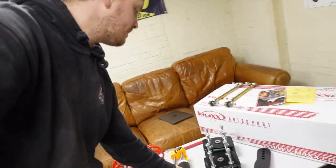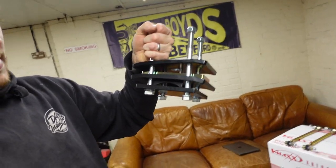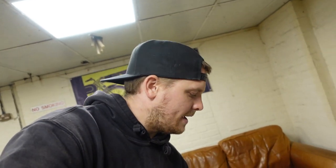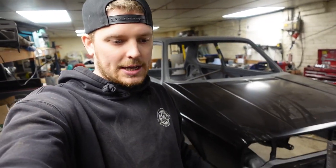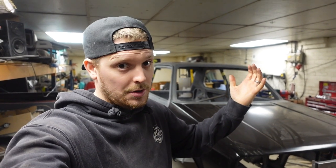The rear end is a beam, so on the rear end you've got standard shocks and all of this slot. I've also got a little Forge relocation plate in there. What we're going to do is something called flipping the beam — at the moment the leaf spring is there and the beam sits underneath the leaf spring. What we're going to do is take that beam and put it on top, essentially moving the wheel up in the arch to lower the van. First thing is to jack it up, work out where to put an axle stand, take the wheels off, and start undoing bits.